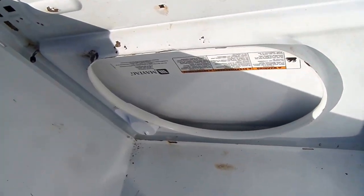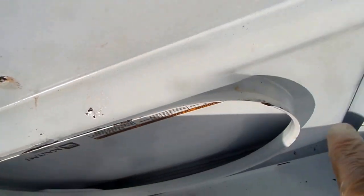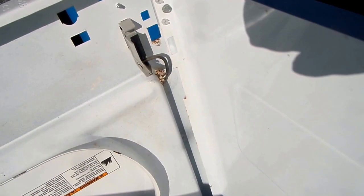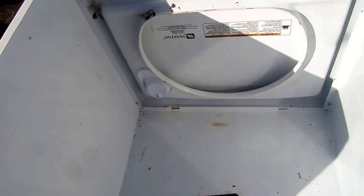When putting your cowl or front panel back on, you can take a little WD-40 and spray it around any rust spots to help inhibit rust, or you can clean them up and use spray paint. Rust spots down on the bottom particularly tend to rust, so you want to hit them with some sort of anti-corrosion treatment or spray paint. Then we're good to go.